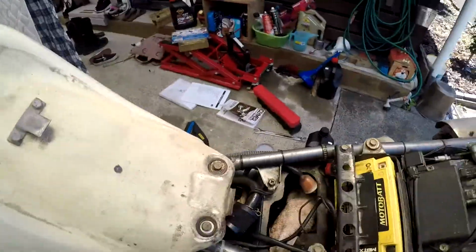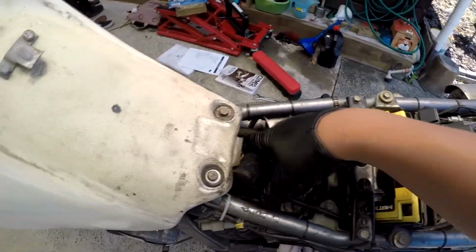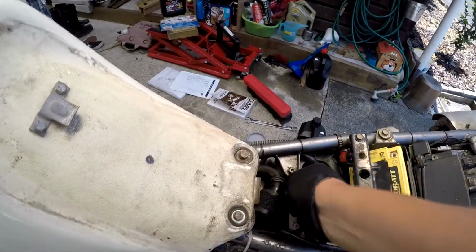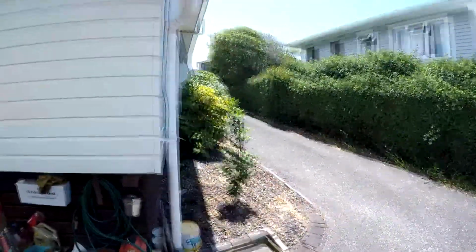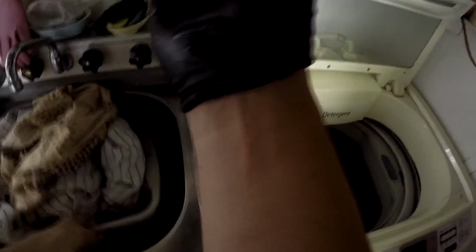And this is the other air filter that you need to clean. This thing is directly connected to the carburetor. And I'm just gonna put a bit of plastic over it. So you take these two over to your least favorite sink. For me, it's the one in the garage. As you can see, I keep my garage in a very impeccable form. And I'll put these down in here for now.